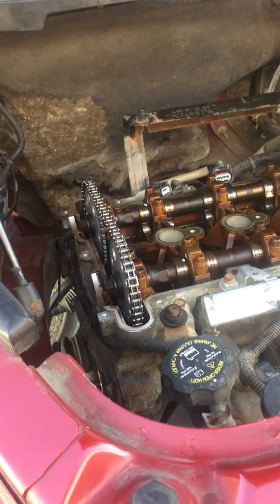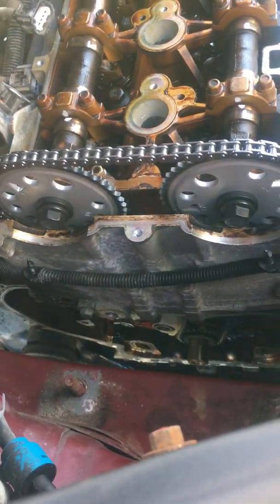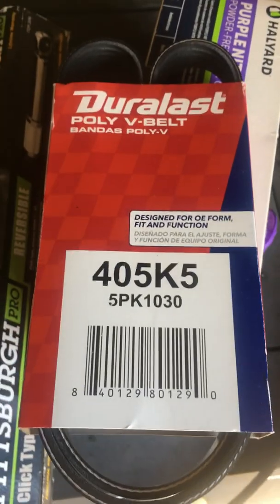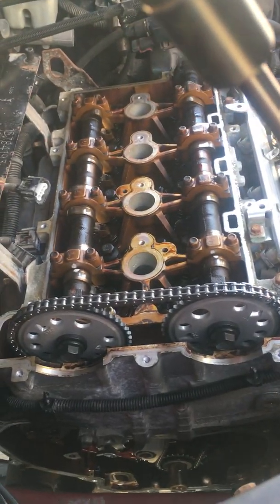I just wanted to give a couple of tips to anyone who's trying to do this job. It's not incredibly difficult, just a pain. Make sure you have replacement bolts for the crank sprocket and these sprockets. Also make sure you have a new serpentine belt — mine was really crappy and I didn't even think about it, cracks all over the place. I should have bought a new one online. I got this Dayco belt for 18 bucks. Any questions, hit me up in the comments — I'll try and answer them if I know the answer. Good luck with your projects. I'll see you next time.